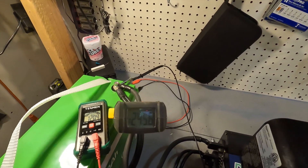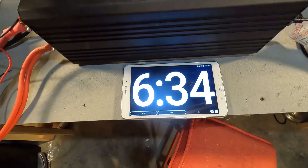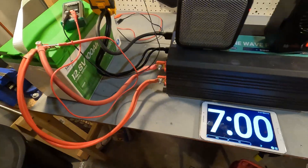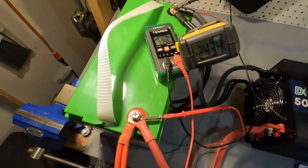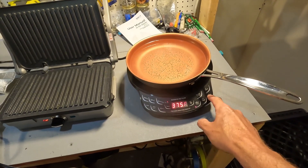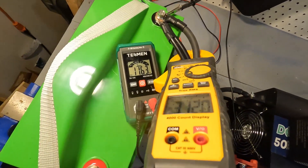Turned on the griddle and our amperage is now 245 amps. The voltage of the battery dropped to about 12.62. Everything about the battery is still relatively cool — no heat spots or hot spots. We're pulling 245 amps, which is concerning. At 7 minutes 30 seconds we're still pulling 243 amps at 11.96 volts. We boost the induction cooktop to 1300 watts max and our amperage is now 306 to 312 amps, with the battery voltage at 11.63 volts.